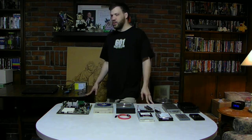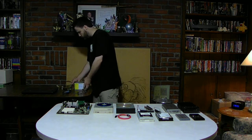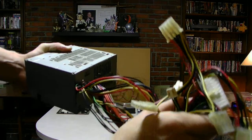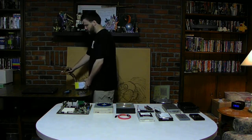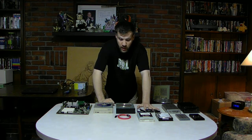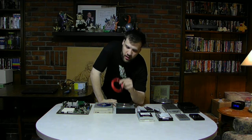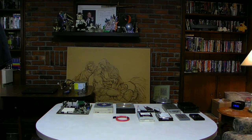I couldn't find the older Dell I used to use — it had only IDE technology. This is just a Molex power supply — it has all these different Molex connectors on it. It's a very common change: we changed from using older IDE cables to one single smaller and slimmer SATA cable to use on newer devices like CD drives, DVD drives, and hard drives.